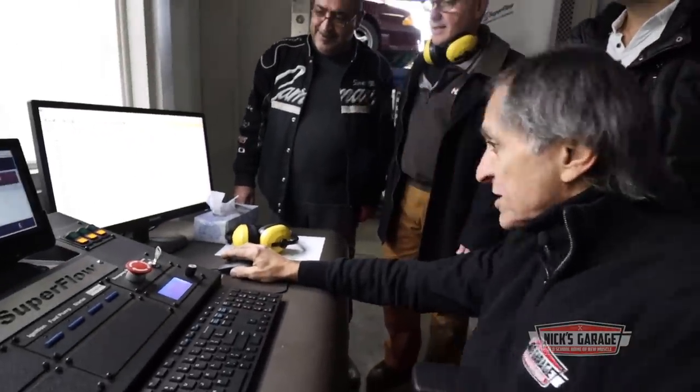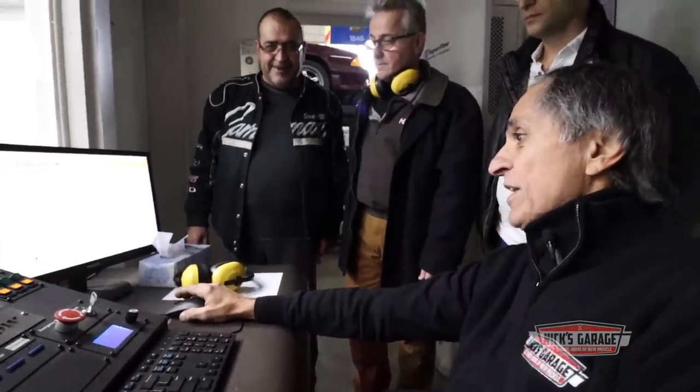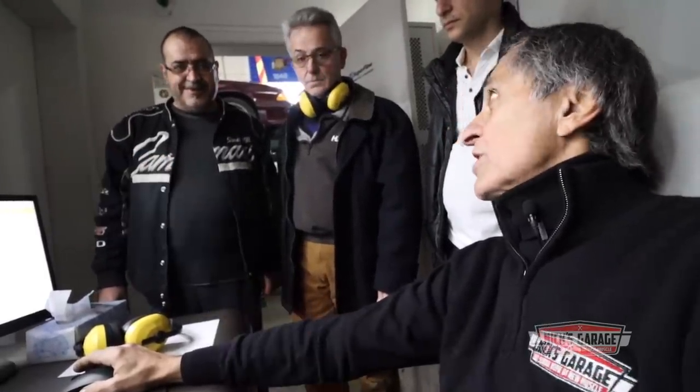Look, I'm running 13s. I like to run high 12s. But then again, I think my customer's going to run full throttle. I don't know if I got jets for this carburetor. I don't even know what kind of a carburetor it is. I got to look at it. Maybe I might richen it up. Maybe we could get 160 horsepower out of it. It's possible.